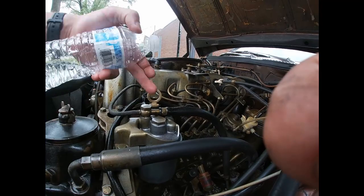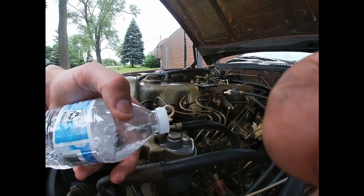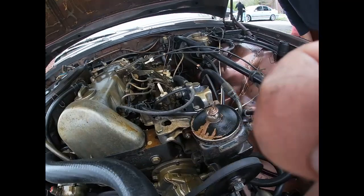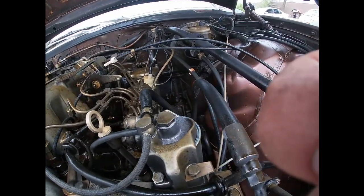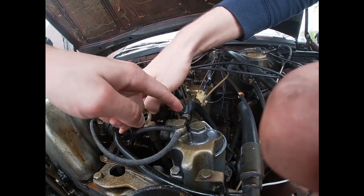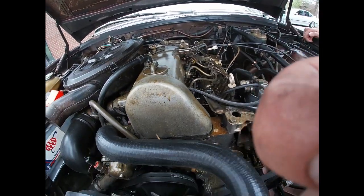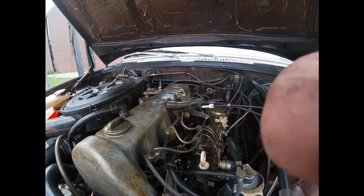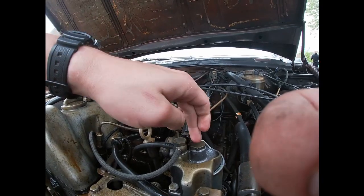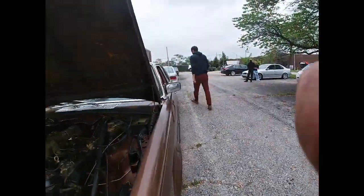Try to tighten this a little more. Maybe it was an old fluid leaking from there. No, it's kind of dry. Oh, that's probably just the cosmoline, or whatever you were using, the fluid film, plus the tire dressing. But there's still fluid right here, diesel. Yeah, fuel. You might have to tighten this a little more. Sometimes you have to re-tighten it.